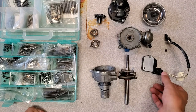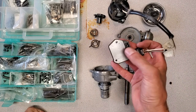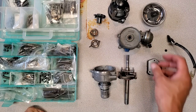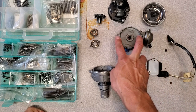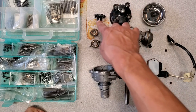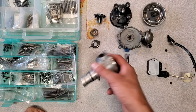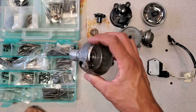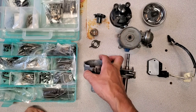I've got it all apart, and good things — for starters, this is nice and clean. It actually had a compound on the module. The vacuum module in here is working. None of the screws holding the cap and base are stripped out. This looks like a new cap. The rotor looks good. Thrust washers seemed okay, and this must have just been really cleaned thoroughly before he sent it to me. I didn't see anything wrong with this, so it's a good unit to start a rebuild on.